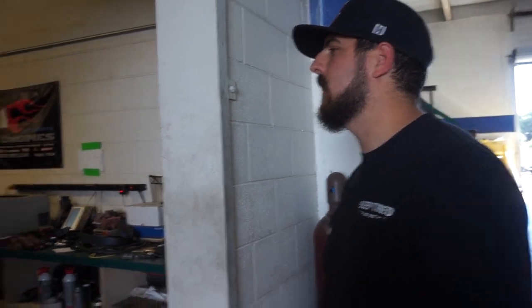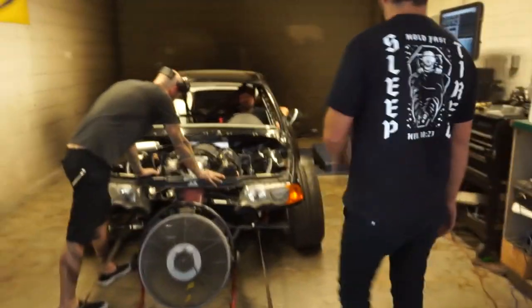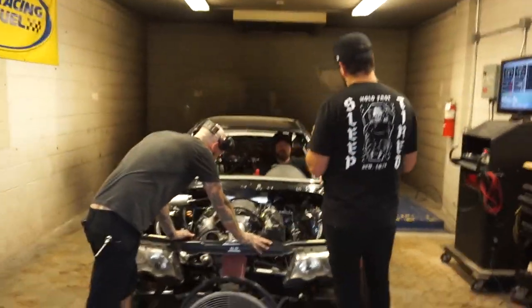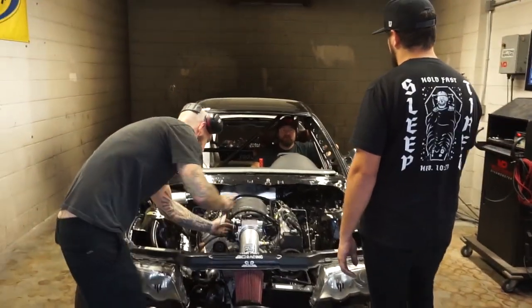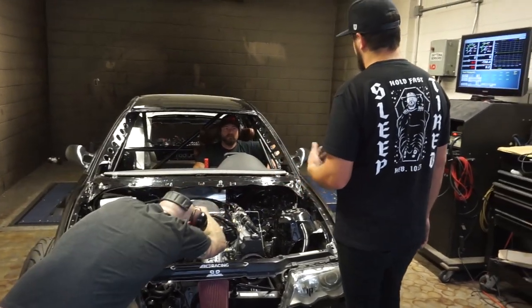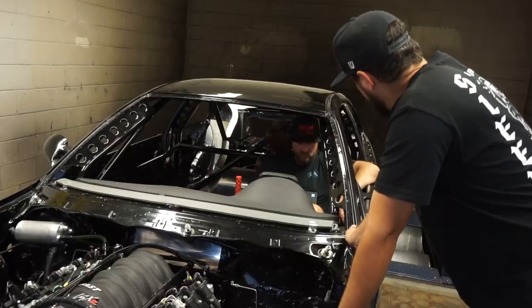They strapped it a little bit different and moved it over and did a couple things. They added the fan to get a little more cold air going underneath. Oh, it's the spring that's on the pedal, not the throttle body one. It's not strong enough to pull it all the way back. It normally is, but it gets hung up sometimes, so I have to add another spring on there. He gave me some springs last week, but they didn't fit, and it slipped my mind doing everything else.